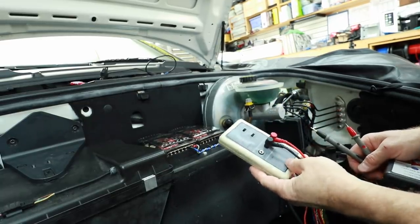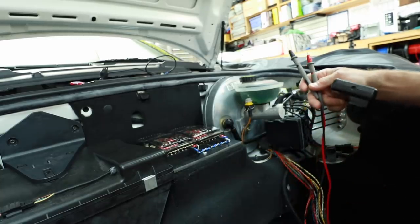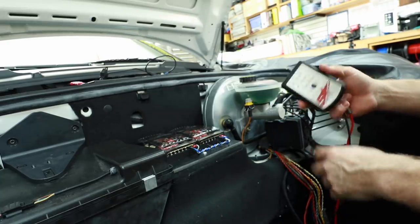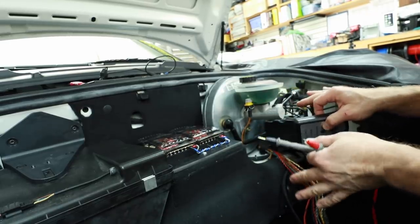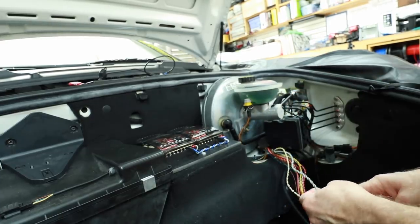To figure out which speaker is which and which wire is which, we're going to use a PT9A polarity tester. It puts out a popping signal into our speaker lines and we have a portable microphone version of it. This will tell us which wire is positive or negative. Now that we have the speakers in we can do that, because this will be the final connection — if we get it wrong that's my bad. Which one is that, passenger?